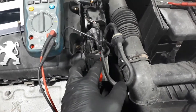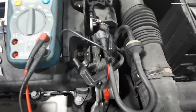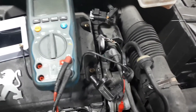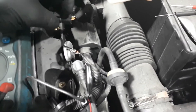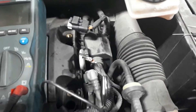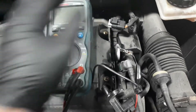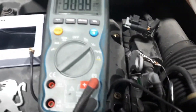I also took the exhaust camshaft sensor out to prove my point, and it's good to have for comparison. First thing we're going to do is put the ignition on and check the voltages on these wires. We're going to have a ground, a 5 volt supply, and a 12 volt supply in this model. To do that I'm going to use a simple multimeter, set on volts DC.